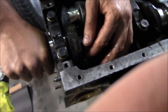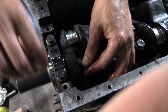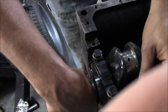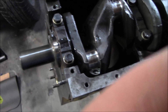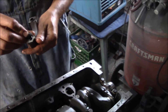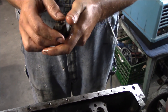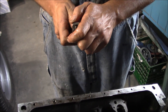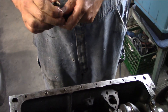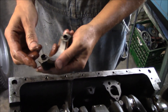If the height is off, you adjust with the crank, not with the piston. You can adjust the crank back and forth until it comes where it belongs. Both bearings have locating tabs — they can't move. We were just talking about putting lube on the bottom of the bearings but we're not doing that. You don't need it, though it's not a problem if you have it.